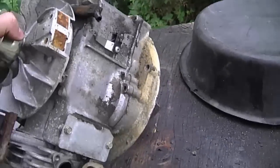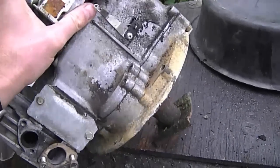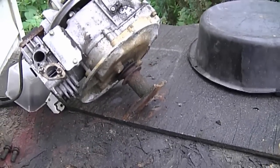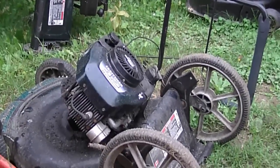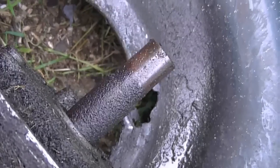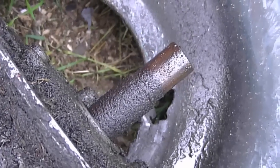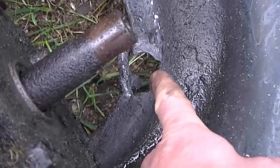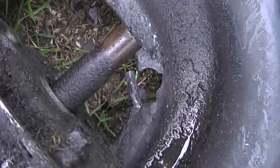It's a good thing to save your crankshafts because sometimes people will come in with bent crankshafts on their lawnmower. There is a tool to straighten bent crankshafts, but it's always better to replace it with a good crankshaft. Here's another Tecumseh engine — this engine actually runs, it's just that the crankshaft is bent. I'll turn it over so you can see how bent it is. This thing was vibrating like crazy — it vibrated so much that it made the engine mount holes much bigger, and then the engine wouldn't stay on anymore.